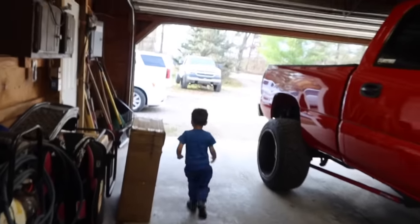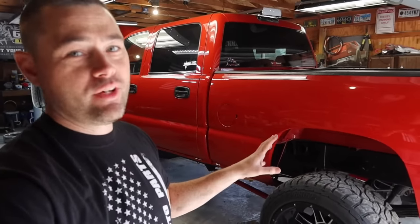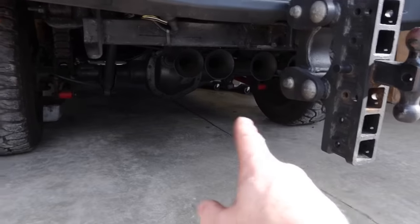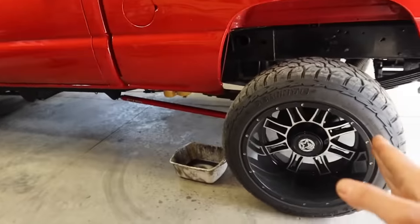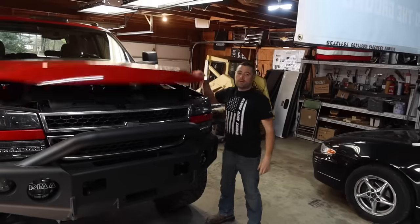Depending on how much travel you're doing with your truck, it's always a good idea to rotate your tires once every oil change. Let me explain how to do a tire rotation — it's not as simple as just taking the rear tire and moving it to the front. For a rear-wheel-drive vehicle, it's called the inverted X: you take the rear tires and the driver's side rear goes to the front right, and the passenger rear goes to the front left on the driver's side. Then your front tires go straight back. I didn't cover the front and rear differential, but it's the same process as the transfer case — remove the fill bolt from the top, check the level, and top it off if needed. Once you put your wheels and tires back on, go to 150 foot-pounds and always use a torque wrench.